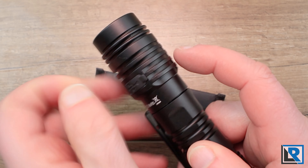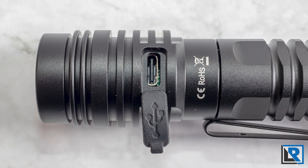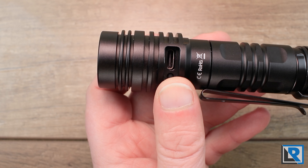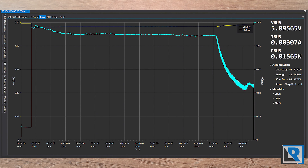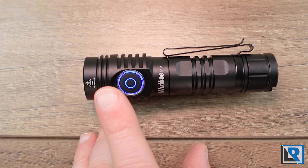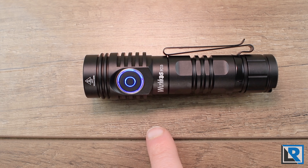The light features onboard USB-C charging through a door that fits well and stays out of the way. The port is deeply recessed, which caused some trouble — several of my regular cables had difficulty fitting in. The included cable works fine, so use something with a thinner connector. Charging from low-voltage protection at 2.834V to full at 4.150V took 2 hours 11 minutes with a max charging speed of 1.2 amps. The charging curve is very flat and tapers at the end. The indicator LED goes orange and flashing while charging, and solid orange when full. The light can be used while charging, but only at lower outputs.